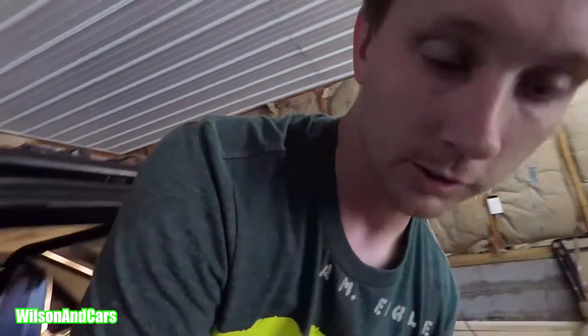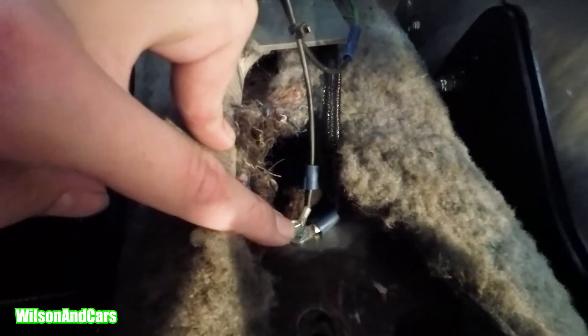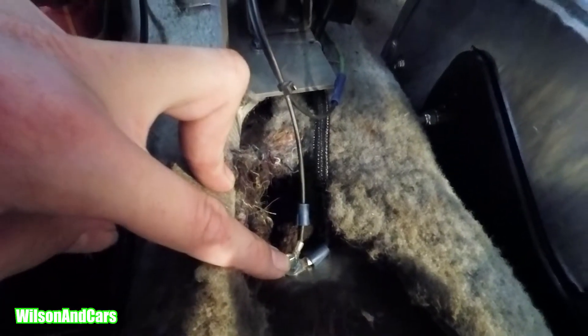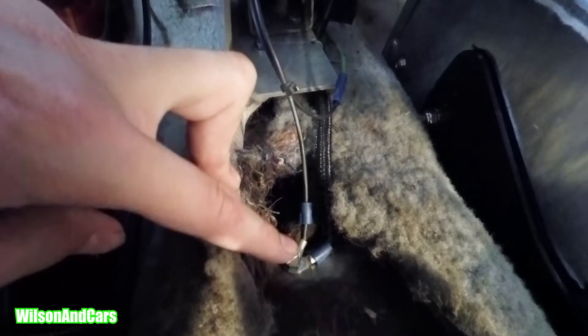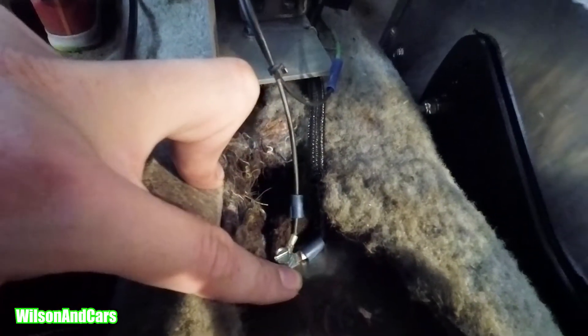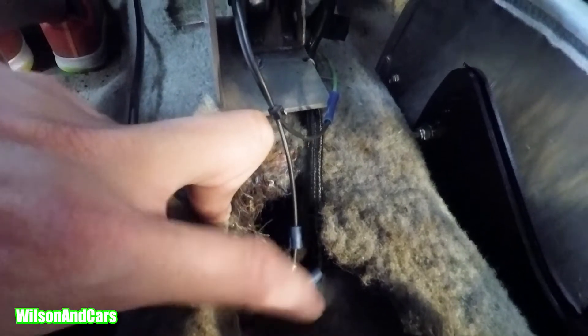On mine I use a ground to the button. Following these wires down, it comes out the back and I've got it grounded right there to the chassis. That may not be the greatest way of doing it — you may want to have a ground come from the battery — but it works pretty good straight to the chassis. I ground some of the metal off to get a good ground.